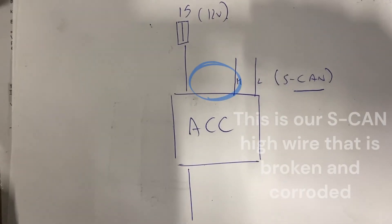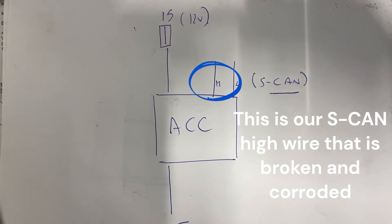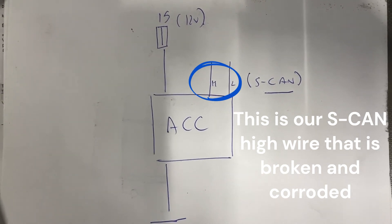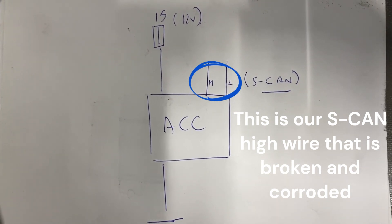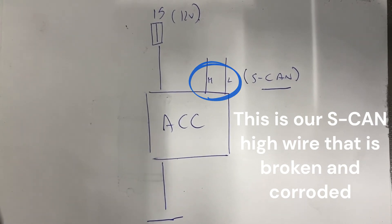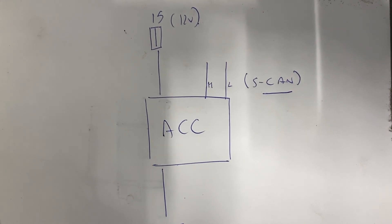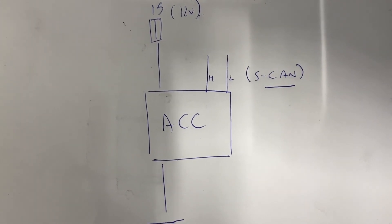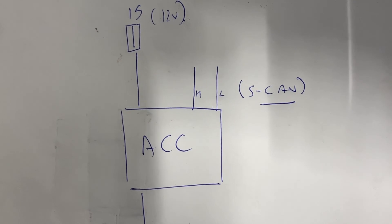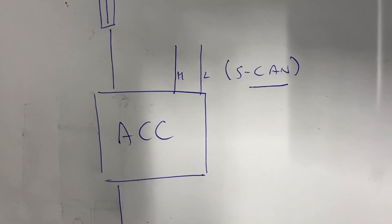We can scope things but sometimes there's no need. I wish I hadn't taken the bumper off, but it only took five minutes anyway. Since I can't show BMW diagrams — I don't want to be sued — here's a quick demonstration of ACC adaptive cruise: dead easy. There's a comms fault code and a fault code for a parking sensor. Four wires: terminal 15 for fuse box, ground, S-CAN high, S-CAN low — job done.